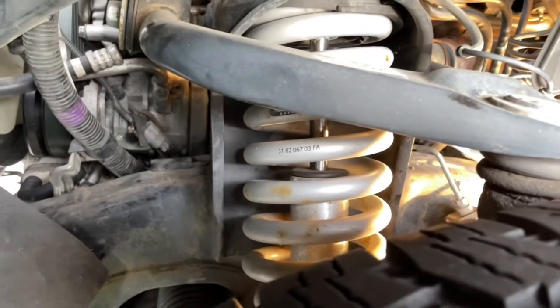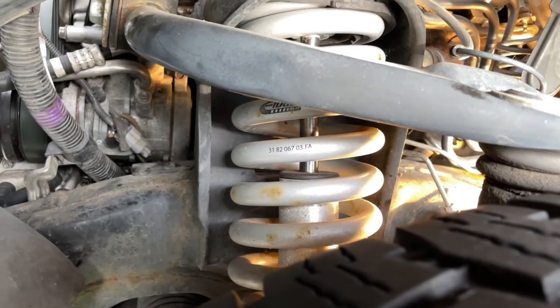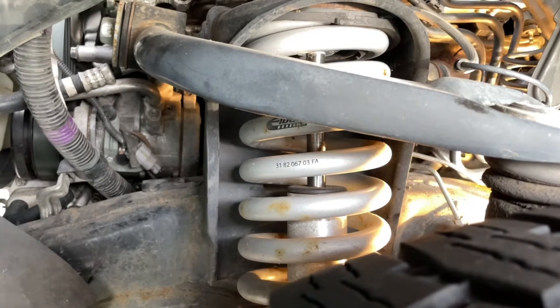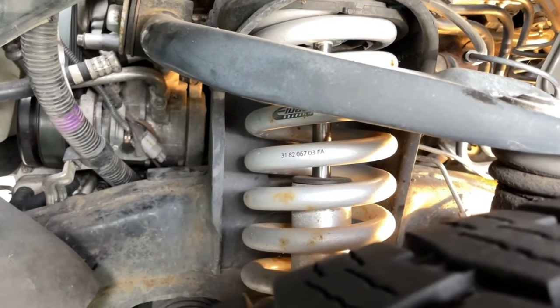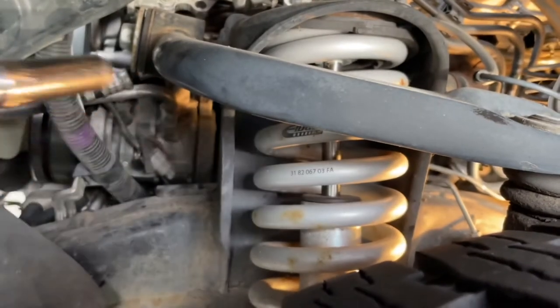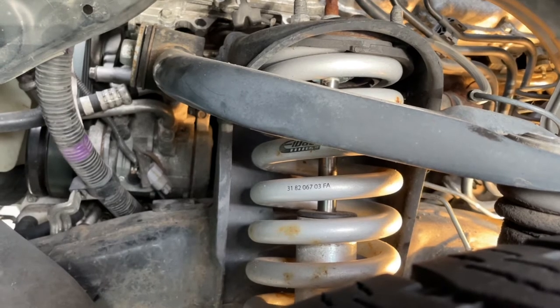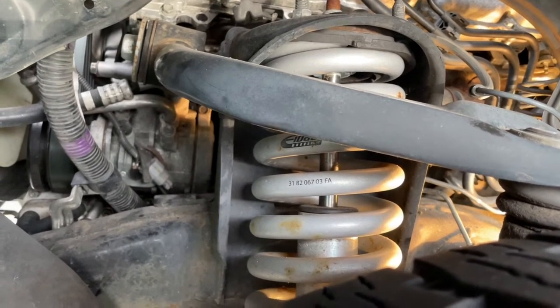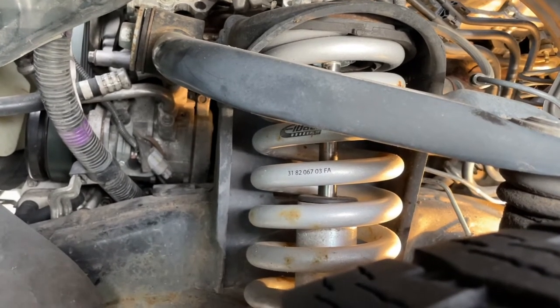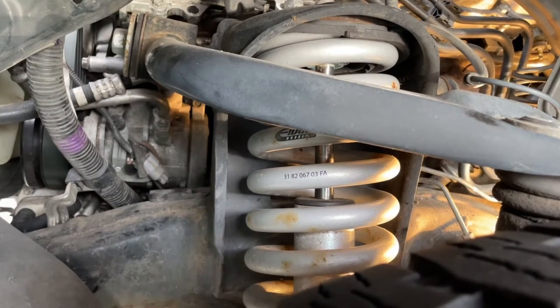We'll get it. It didn't take long actually to get that hidden nut out. I just reached with the 3/8 socket with a 3-inch extension. I was able to reach around with one hand behind it, holding the socket and break the nut pretty easily, using my right hand to reach around the right side of the spring there and kind of hold it steady. It came right off.